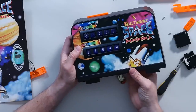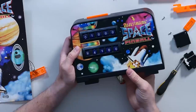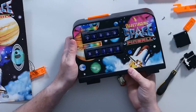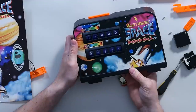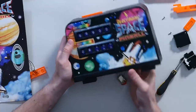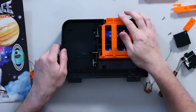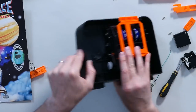So for each point you get, all this will do is send a little pulse out to the motor for a set length of time. And once that's gone round for the first 900 points, it mechanically ticks over to the next. And so on and so on. I wonder how quickly you could fire this up and still get the points counted correctly. Once you reach your high score, you just set 999 — because it only moves up in hundreds anyway, so there's no need for a high score to save. And then you've got a physical reset which lifts all the gears clear at the bottom — they're slightly spring loaded, so they return to zero.